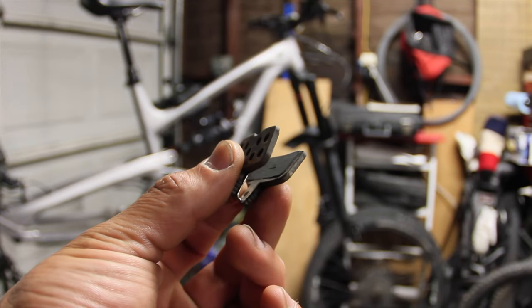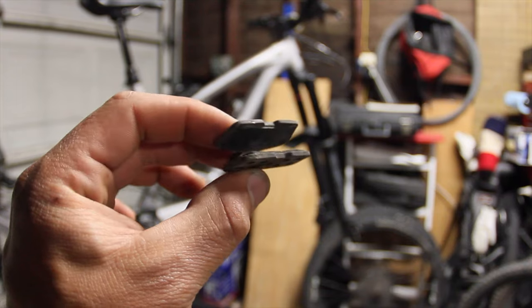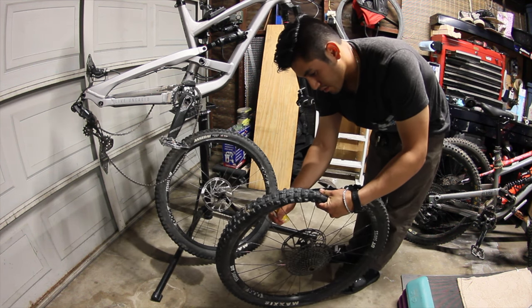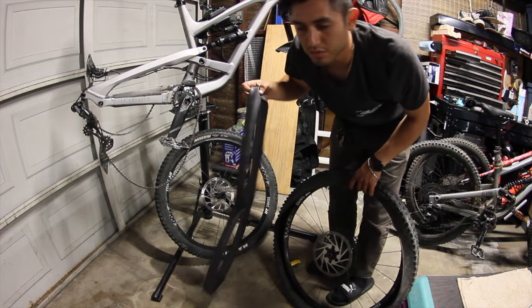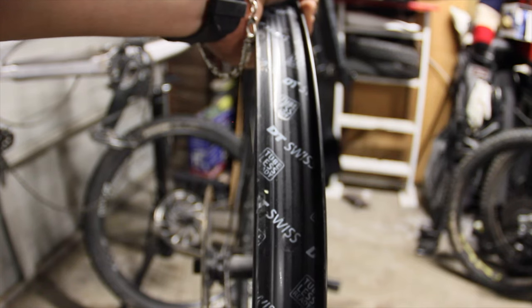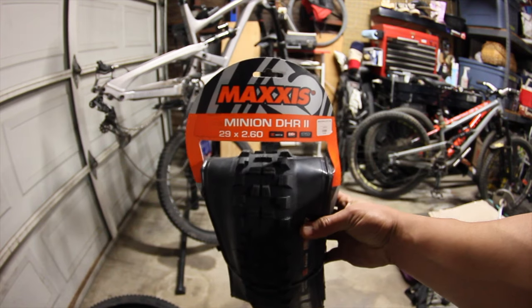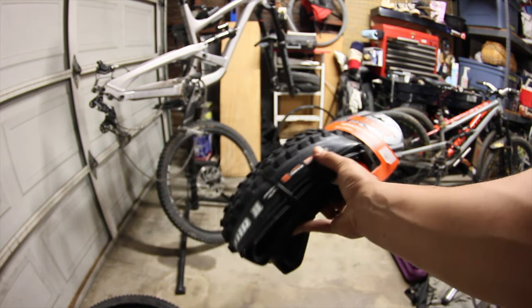He's had this bike for two years and loves it. His rear brakes were done — had nothing helping him out in the back. His front brakes probably aren't going to be as bad. It looks like he has rim tape already — tubeless ready. These are still good though, I'll give them to him so he can save them. He has a rim strip on these wheels — says tubeless ready by DT Swiss. Going to throw in some fresh valves for the tubeless setup. Maxxis DHR 29 by 2.60 going in the rear.